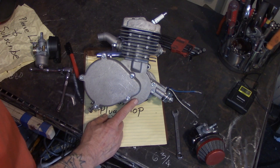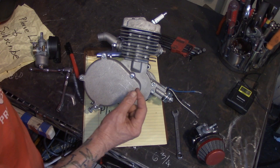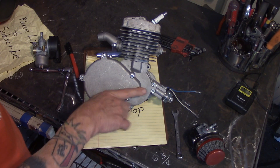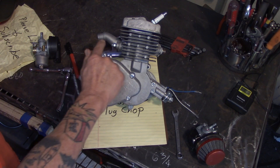Another thing that causes power to taper off is how well your crank assembly is balanced. Some sellers will sell you a kit for $180 and say it's got a balanced crank — but some kits are better balanced than others. To properly balance a crank assembly to precision takes time and money, and only your better custom builders are going to take the time to do that. If your crank assembly is poorly balanced, that's going to limit your RPMs and cause that power band to taper off.